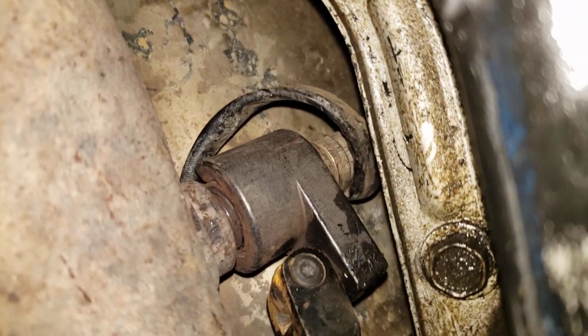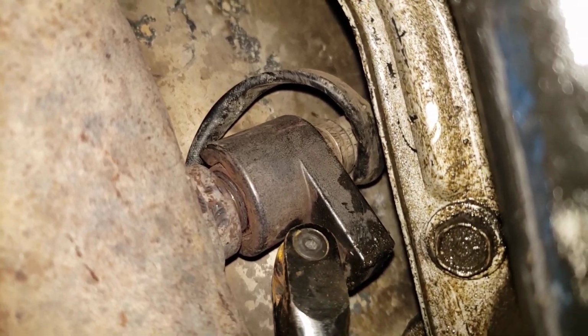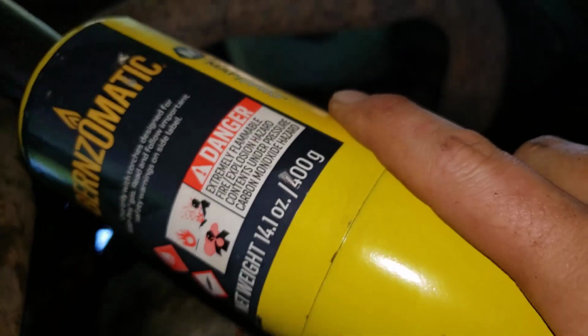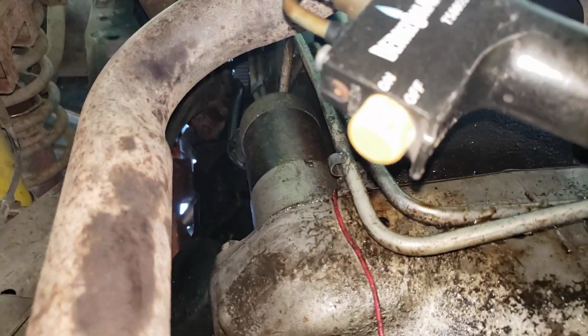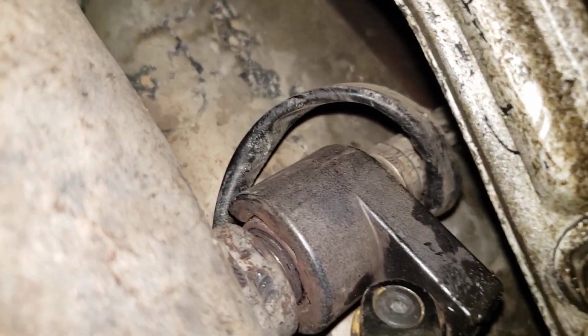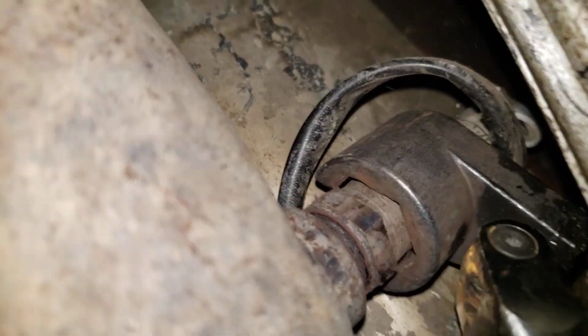But really, all you have to do to get any O2 sensor loose is you just bring in your old friend Mr. Yellow. This is Map Gas, and you let Mr. Map Gas give this old O2 sensor some kisses. Let him give it lots of kisses. You're going to get this thing red hot. If I can get this stupid thing off. Yeah, it's all twisted up.